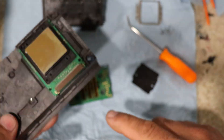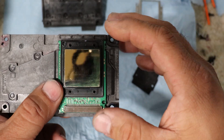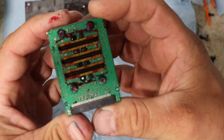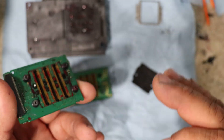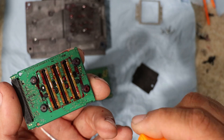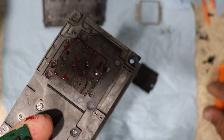This one is not for an ET, this one's for an XP. It's pretty much the same — there's a couple of differences on the plugs and stuff like that. I removed the screws on this one, removed everything, and this one was pretty tight. I didn't apply heat, so I broke this one. I just want to show you how a clog looks like. See how the post broke — because they are pretty much stuck in there. The XP — be careful. If you have an XP, please be super careful. They put a lot of sealant on it. You might break the posts off, and if you break the posts, you won't be able to put the four screws with the metal plate again. Pretty much that printhead is shot.